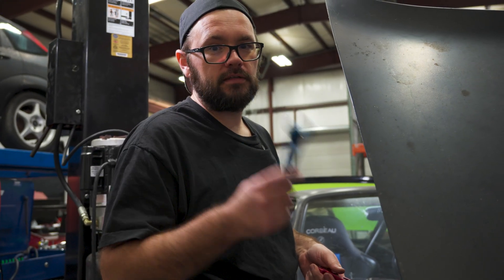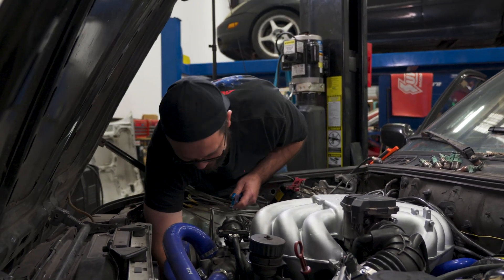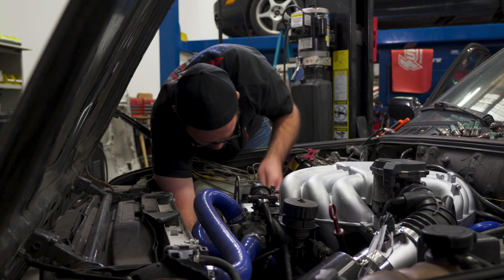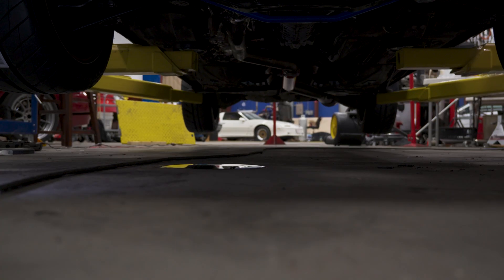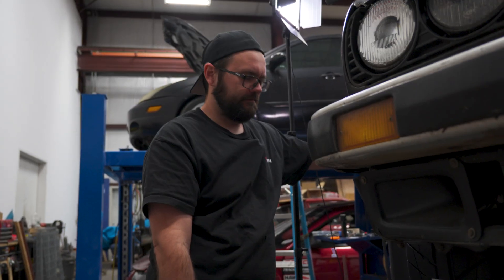This happens on any project car when you've made a lot of changes or done a lot of fixes and then start it up for the first time. It's always good to have a second set of hands to look everything over, especially if you had a fuel rail off or you've worked on the oiling system. My E30 just marked its territory — it's because I didn't tighten one of the fittings. Only finger tight. Let's check them all just in case. Note to self: when you're working on this, do all of it in one shot. Do not walk away in the middle of it because you'll forget. I'm going to put this thing up in the air and just check them all. Nothing a little oil dry can't fix — no big deal.